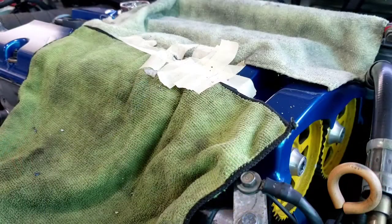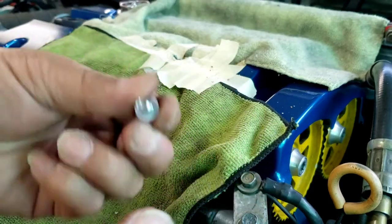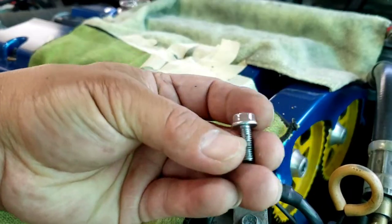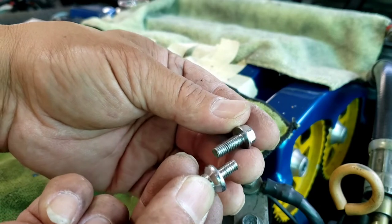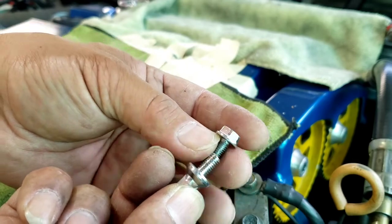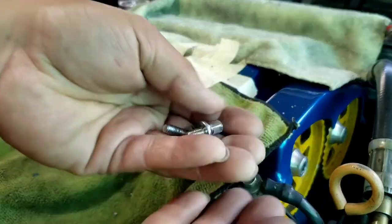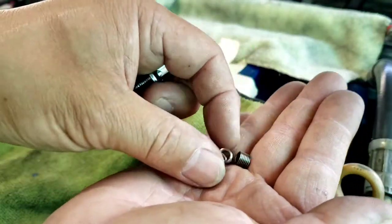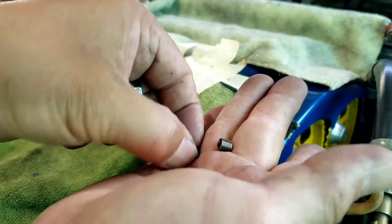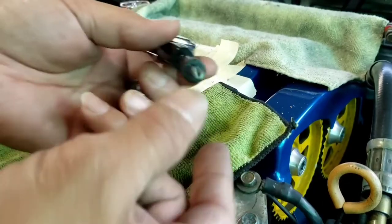And that's it. Now I'm ready to put on the helicoil. Just to let you guys know, these are not the original bolts that go to that valve cover — the center one here is the one that's supplied with the kit; this is OEM. I think the reason why I pulled the thread off is because the bolt is too short, but I don't have the whole set so that's why I'm using one of these. I'm going to put two helicoils in — this will cover the whole thing and I think it should be enough.